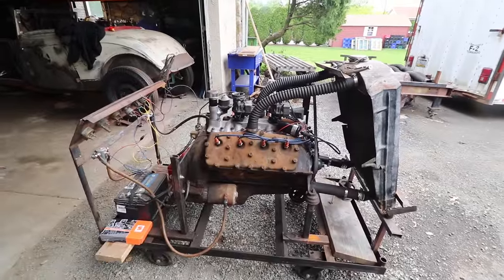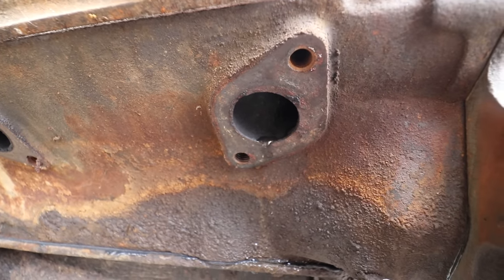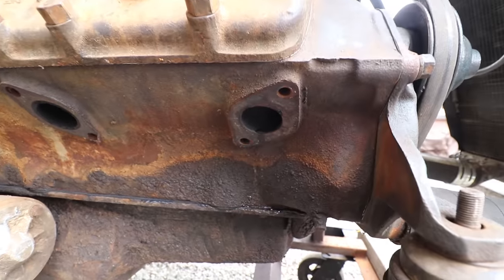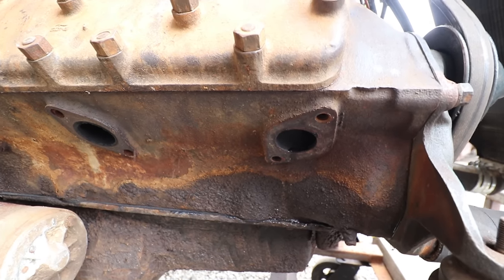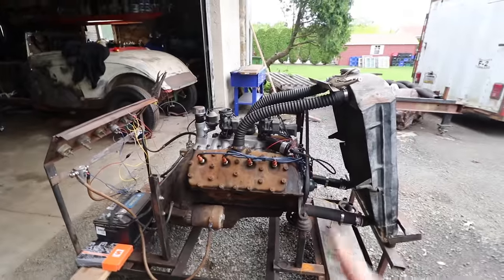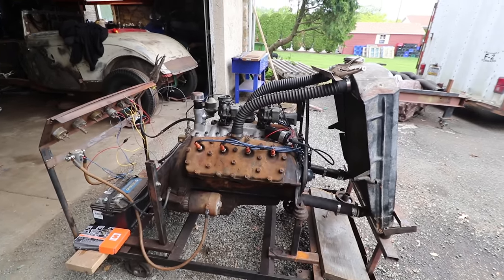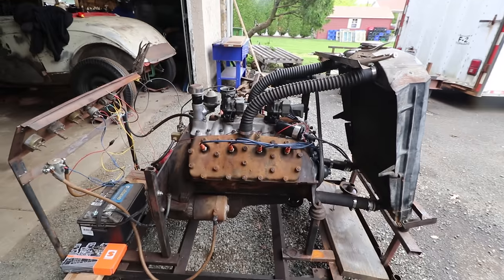So we're gonna start blowing this thing apart because it is still leaking that fast out of it. The crack is actually up inside and around the curve of the casting. It is cracked, so I couldn't even get in there to weld it, and there's really no way until we get some sort of laser robotic welding to go in and fix flathead blocks, we're out of luck. So this engine would be a great engine for somebody to run in a little dragster or something, or a car that was just doing track time, and run no coolant in it, maybe fill it with cement like the racers used to do, or just run it with no coolant. It would be totally fine, but obviously you can't run it in a street car where you actually need coolant